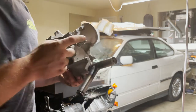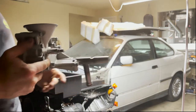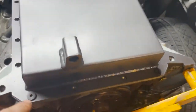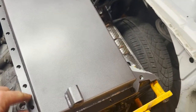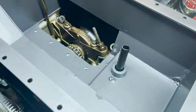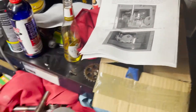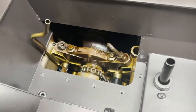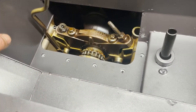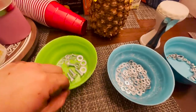We took off the drive gear, put the T-fitting in, and now we can put this in. You have to do these two bolts first — they line everything else up — then put the rest in. It runs across here and across the bottom. The instructions are pretty clear but miss some minor details. I hope this video clarifies things; if not, leave a comment and I'll personally message you. We're going to put the rest of the screws in for the pan now.